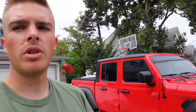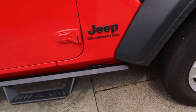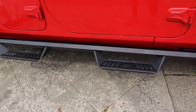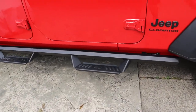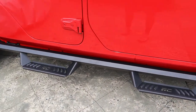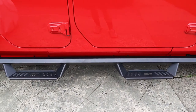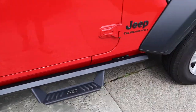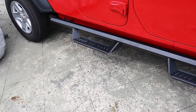That's it for today — Rough Country AL2 drop step install. Really easy, like I said. Just the three bolts that go into the body and then the four nutserts which go right through the pinch weld. The step slides right in between the pinch weld on either side. Once it's in place, just bolt everything in.